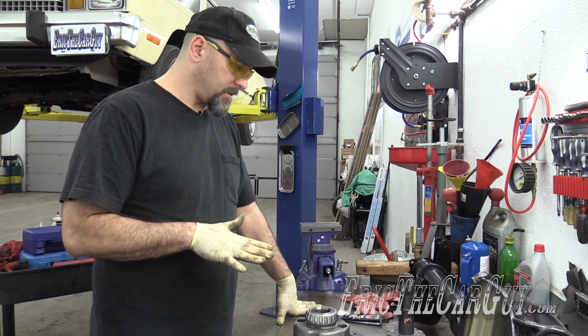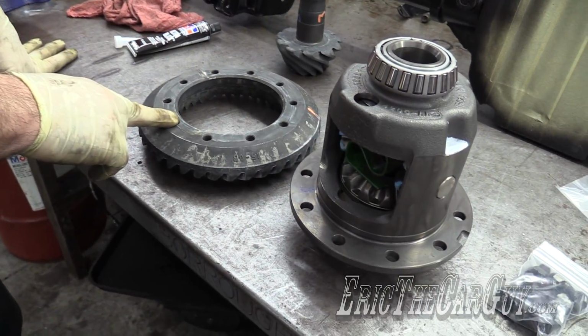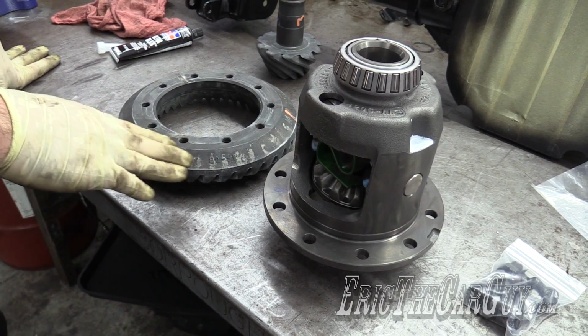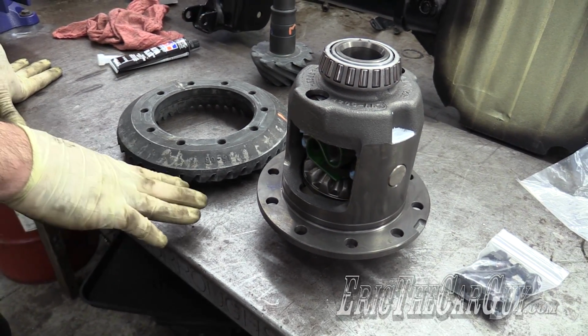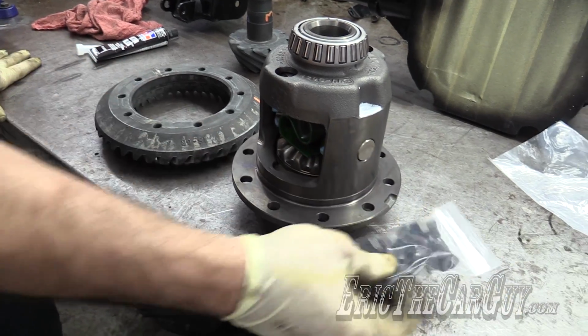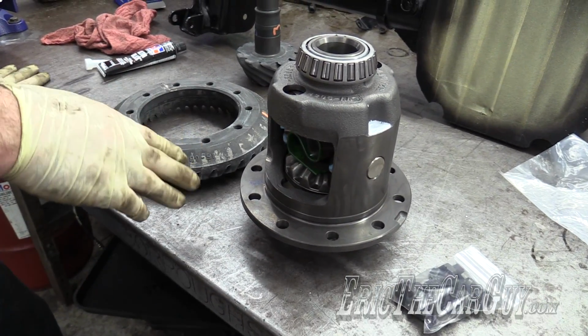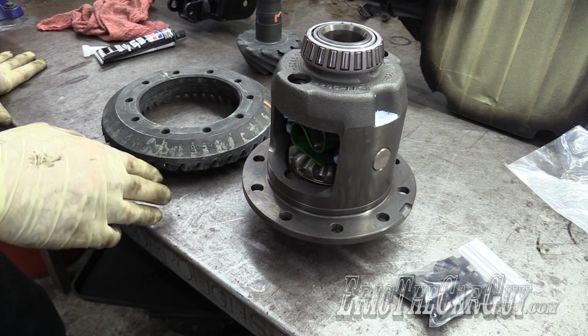Now Ford says to install some sort of Loctite retaining compound on the backside here. I'm not doing that. I will also post a link in the description to the PDF that goes to the instructions for this because it contains other valuable information. That being said, the new bolts come with Loctite, so I'm not too concerned about that, but I'm going to get it started with 2 bolts, take it over to the press.